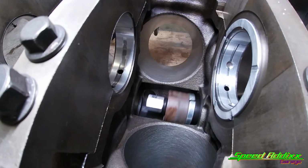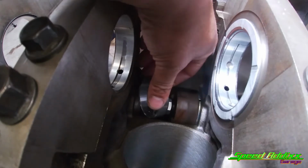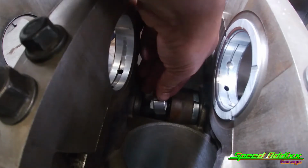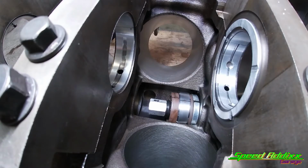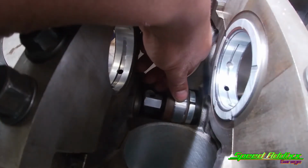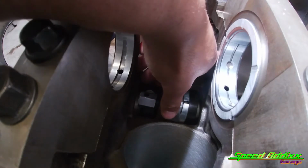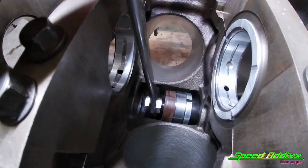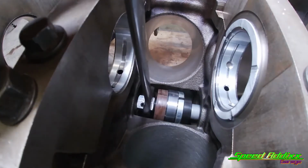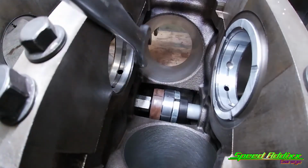Slide this tool through the front. Clock my bearing so that it goes in there. Slide it over top of the line that I got lined up, which is, golly, this block is sharp, man. I probably just got some blood on my hand. Put my wrench inside of there, tighten up on this thing, try my best not to move my line orientation. That should be tight enough.